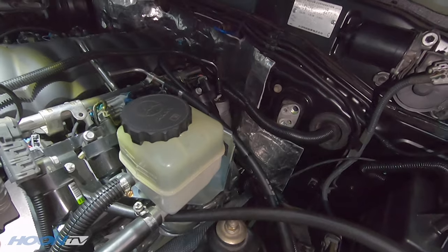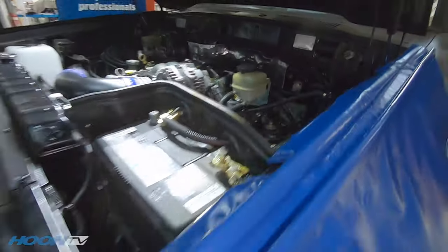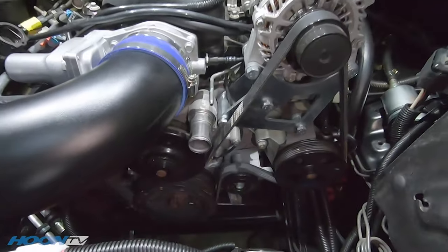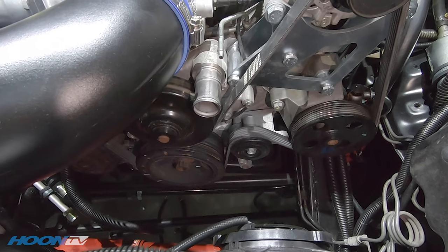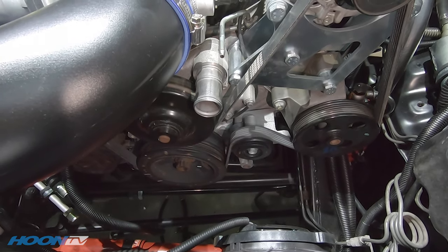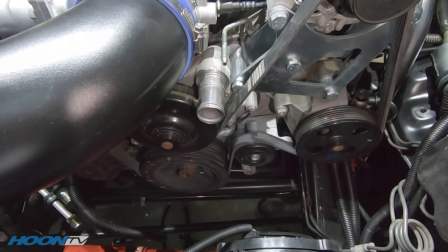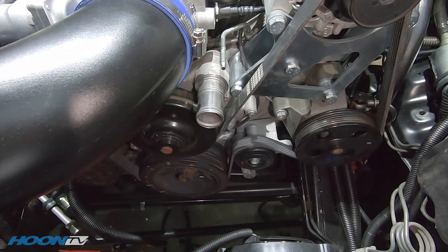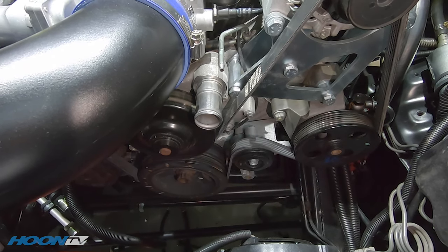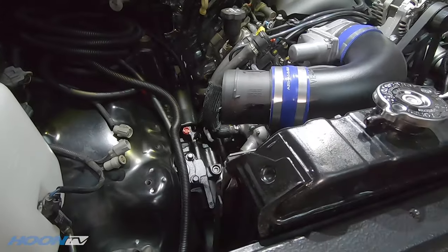Next step after this, probably after starting it up, is to sort out the power steering lines and air conditioning lines. There's a full Marks 4WD hose kit coming next week — hopefully on Monday — and that's what's holding us back from starting it. We could start it for 30 seconds but I'd rather fill it up with coolant, do it all at once, start it, check for leaks, and if nothing's leaking just let the thing idle. It's so close to firing up.